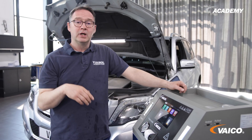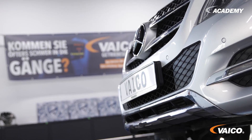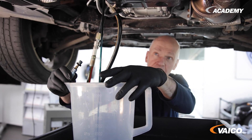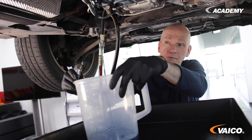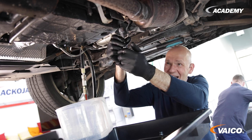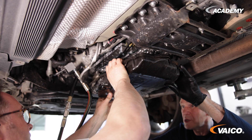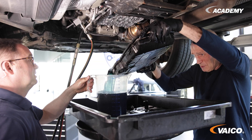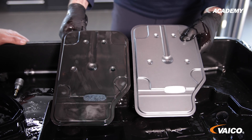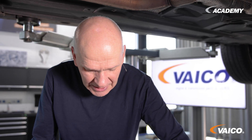The process is now finished. We can already see a clear improvement in quality here. Of course, we won't get it to 100% because there is still a bit of residual dirt, dust, deposits and particles in the fluid. But it is already very good. The next step is to change the filter. Now we catch the fluid from the transmission and measure the amount to refill it later. Here you can see the old dirty filter very well. Opposite this is a new filter. In addition, here we have the deposits on the magnet, which is totally saturated and can no longer absorb anything.